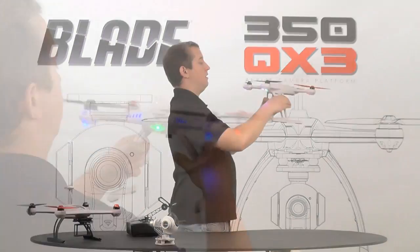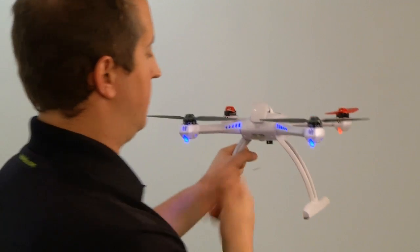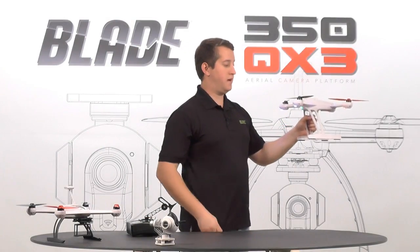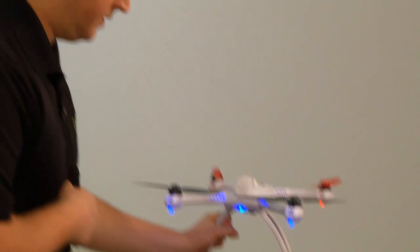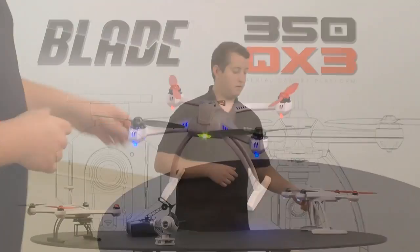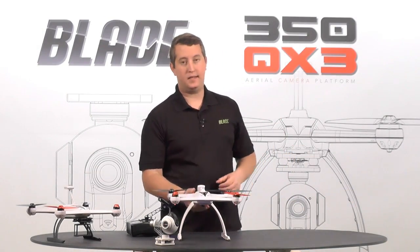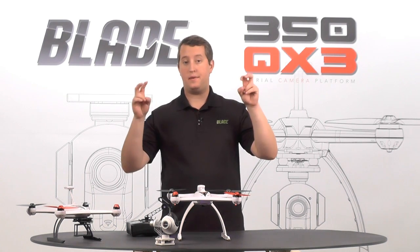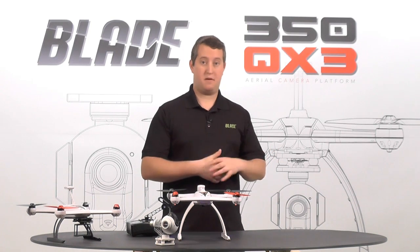Once we're done, the model will give you a green light. You have about 60 seconds. It took a little longer, so it actually finished right in time. The model will go back into a boot sequence — we'll set that down because it won't boot otherwise. Once the compass calibration is complete, the model will make an ascending tone, a happy tone, telling you that you did it correctly, and then you will notice that it flies much better in the air.